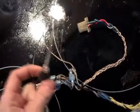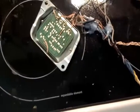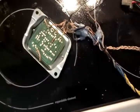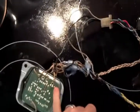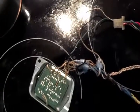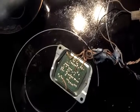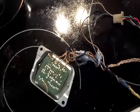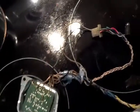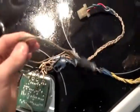One modification I've made since the last iteration is the light. What I found was that the regulator, as designed for Ford trucks, has the switched 12-volt ignition source going through a dummy light on the dashboard to indicate whether or not the charging system is functioning. That resistance of the light, because it's wired in parallel with a 15-ohm resistor, turns the light on or off depending on the current situation. That resistive load on the incoming 12-volt circuit is designed to be there.